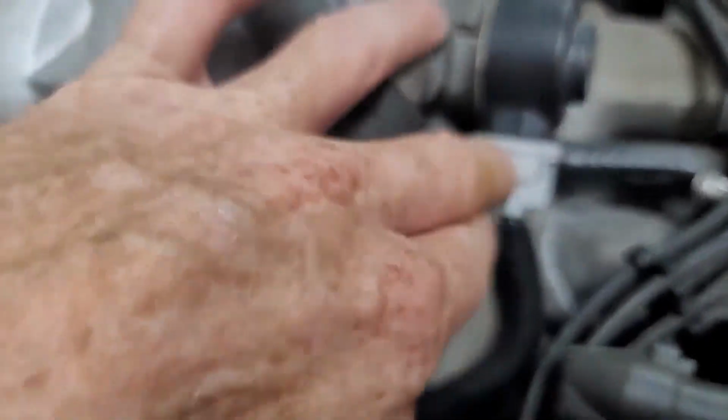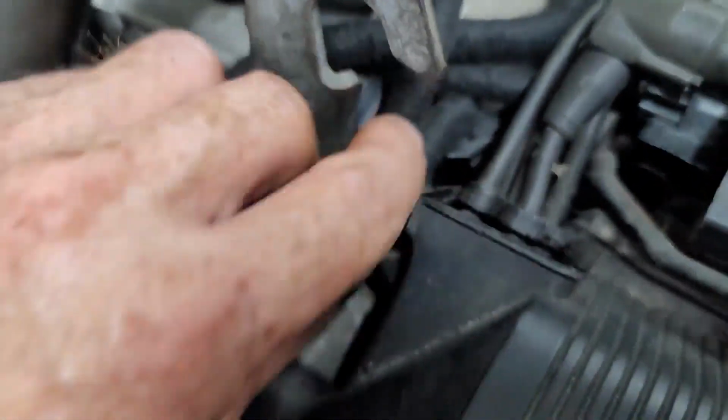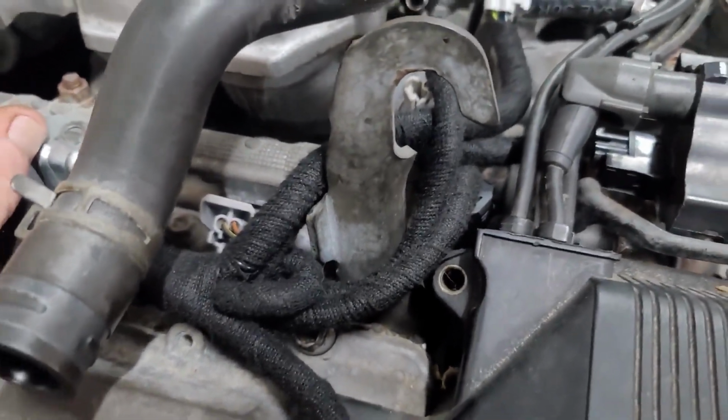Okay, so you've got a new idle control valve, 6-pin connector on there. You've got your water temp sensor connector, that's a single probe. You have another one, 2-pin down here, that is for your EFI water temp sensor. Okay, very important. If it's not plugged in, the system will think that it's running at minus 40 degrees and she will not start. Well, she'll overfuel dramatically.